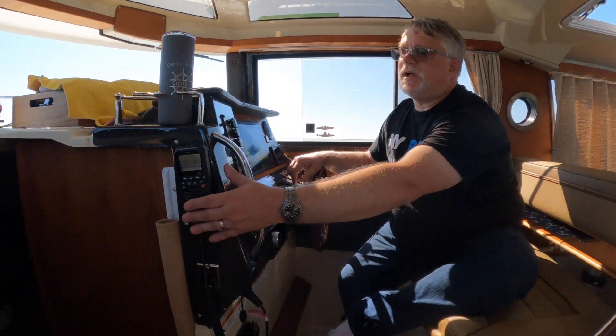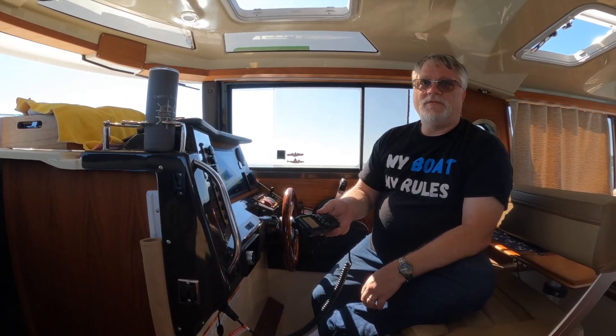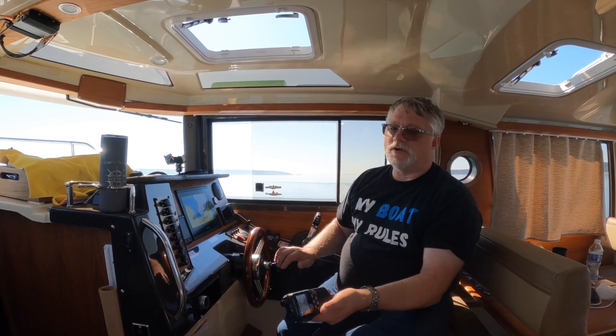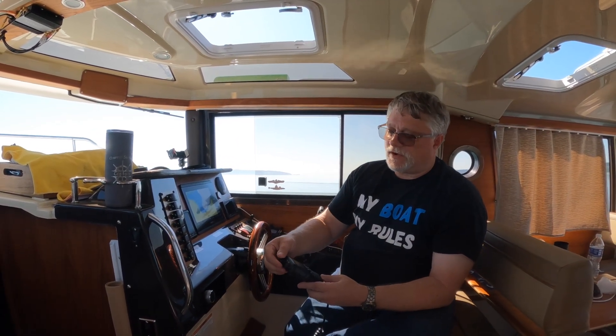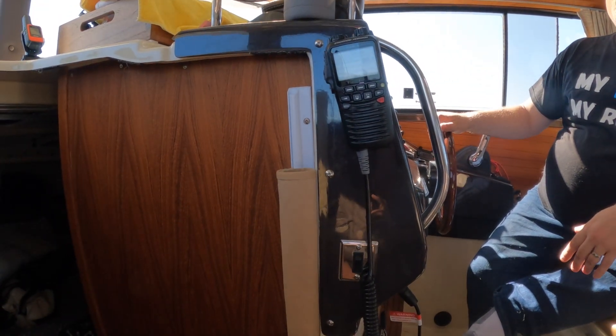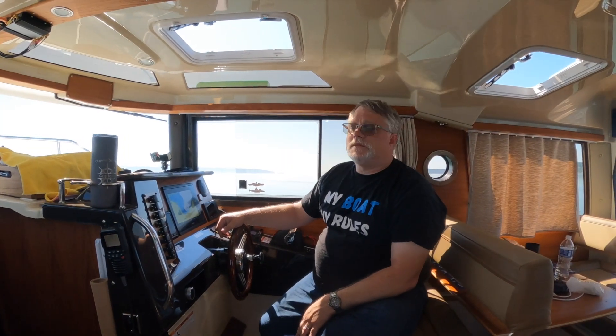I also found it was a little difficult to hear sometimes, since radio transmission isn't always fantastic based on who's transmitting and how far away they are. So an external microphone seemed like a great idea. The best thing I did was add a RAM 4 — a remote access mic. It plugs into the back of my main radio, gives me all the buttons, a microphone, and a speaker so I can hold it to my ear and drive using all the controls. It's like having a second radio without actually having a second radio.